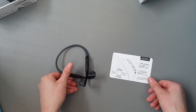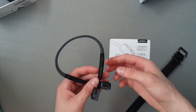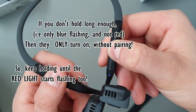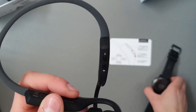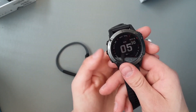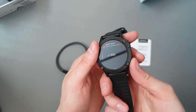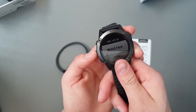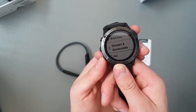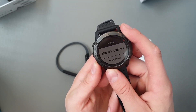Let's turn them on. Press and hold the plus for five seconds. Now on the Garmin Fenix 6, press and hold this button here — if you don't hold it, it'll just scroll. So press and hold. We have the watch face, clocks — we don't need that — current activity, controls, face, music. That's what we want. Click select, providers, no headphones, yes, add.